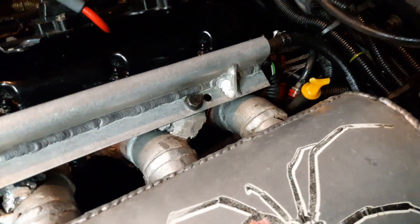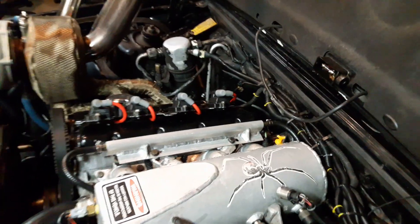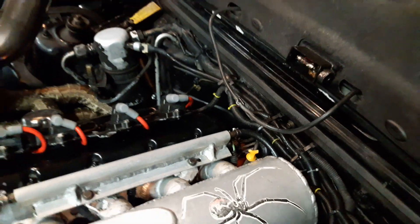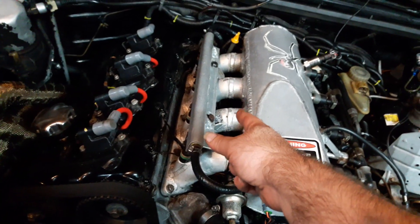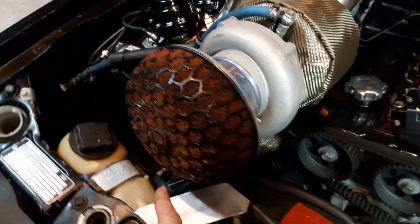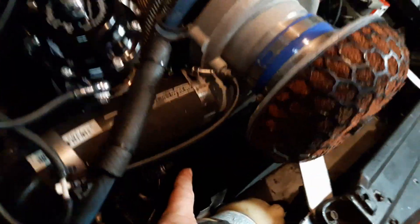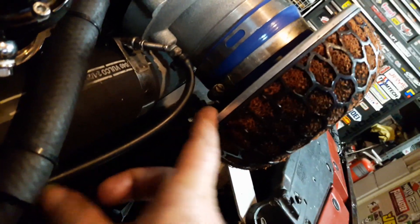Also make sure to check your PCV box, your flame traps, and your compression. If you get an excessive amount of blow-by where it's puffing out smoke when it's running real bad, you know it's pretty worn out or something's wrong. In my case I have the factory flame trap box underneath here from the eight-valve — it's like a '93 — and it routes all the way back here and up to my catch can, which comes all the way up to the vacuum where it gets suction.